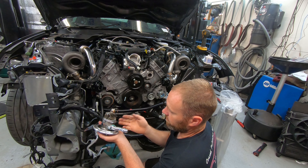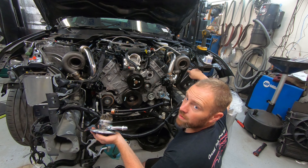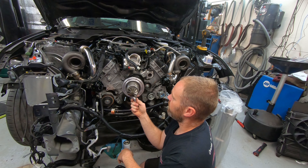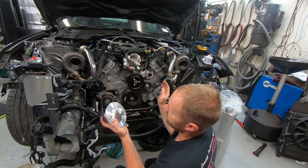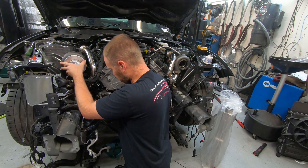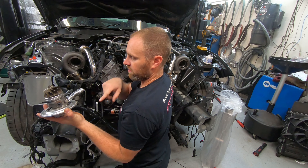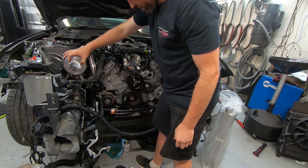In the meantime, I decided to try and do the drain pipes to get an idea of where those are going to run. I put this one originally on that side, but since I tightened it down, I don't want to remove and install the gasket again — instead I'll transfer the cartridge to the other side. But on this one, I cannot move it to the correct position, so the turbo does not sit right. You want the drain on the bottom and the feed on top, because gravity — you want the oil to drain out as best as possible. It was canted no matter what I did, so I'll set it over on the other side and see if it works better. Even that doesn't work very well, so that fitting just might not be good for this system.